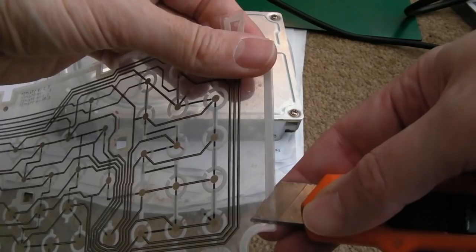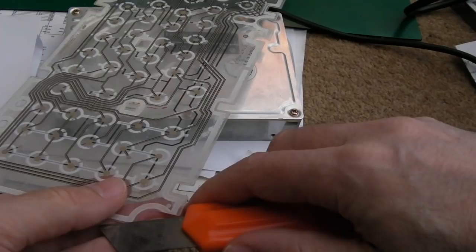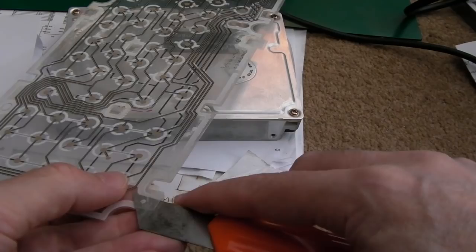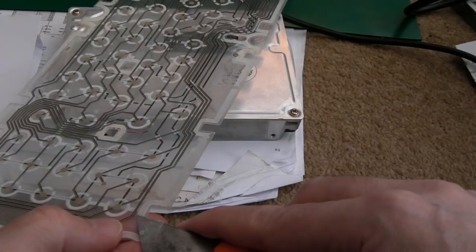That'll do. Let's try and find where we just started on that corner again, wherever it was. There you go. The knife goes in really easily. Again, I'm watching the end of the blade there. I don't want to go near that trace. And continue. Now, this bit's difficult because can you see how close the trace is to the bit we're separating? So, yeah, very careful and slowly.